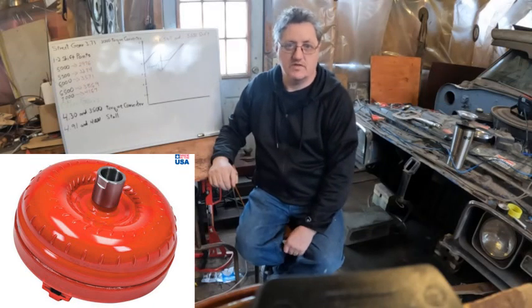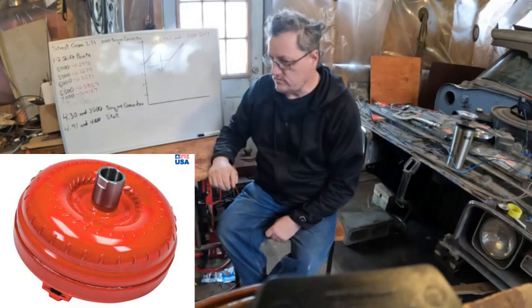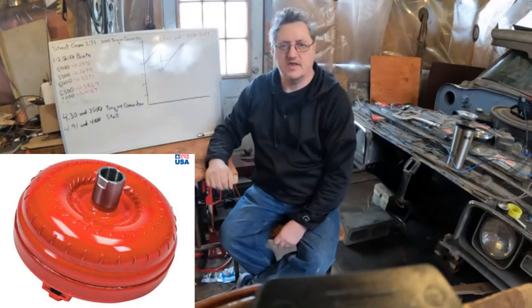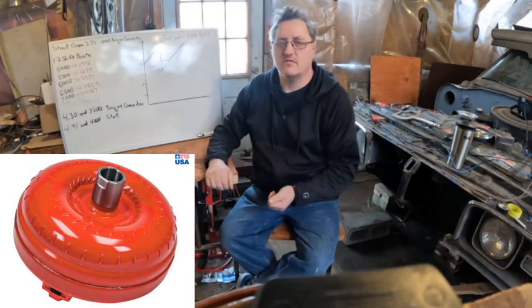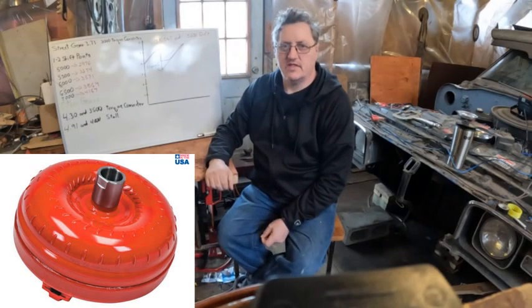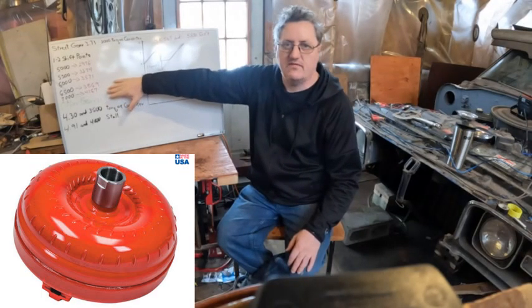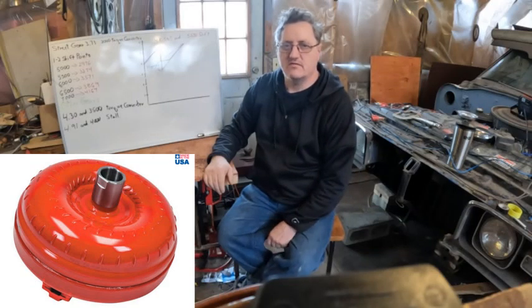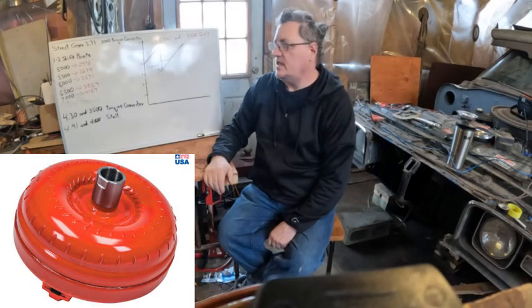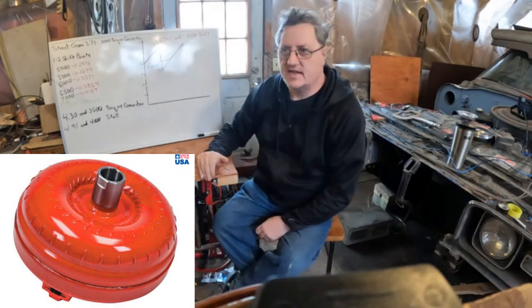The purpose of a torque converter is mostly drag racing, so now I'm going to look at how you match up your torque converter to the shift point you use. I'm using the one-to-two shift point because the two-to-three RPM drop is actually less in any transmission I've seen. I have them listed here: 5500, 6000, 6500, and 7000 — that's about where it would be for a street and strip car. I calculated these using a Wallace Racing calculator.